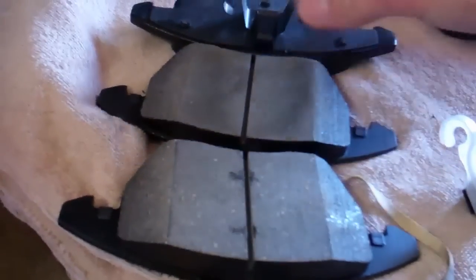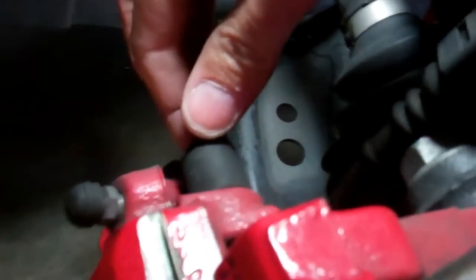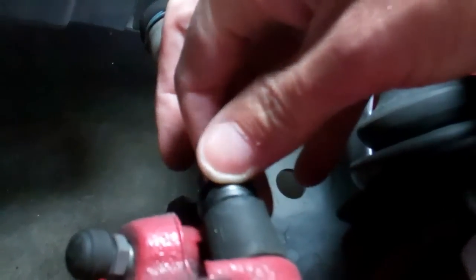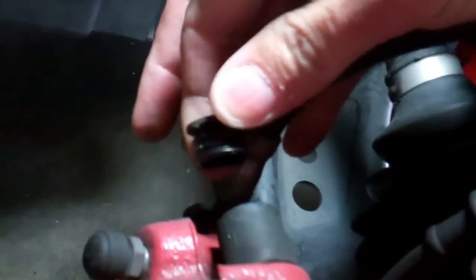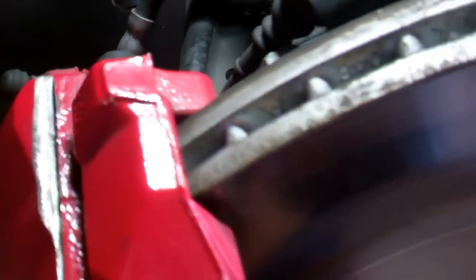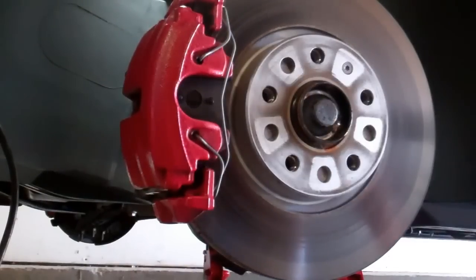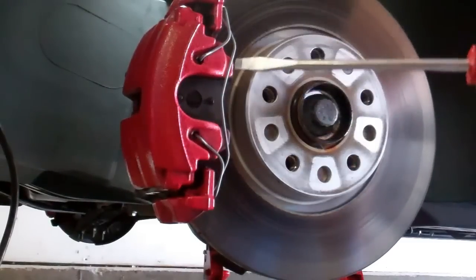And the rest of it, three pads here. I'm going to start by taking off the stock caliper. The first thing I like to do is pull off the little caps — there are I believe allens in here. I haven't done this job in a few months so I'm going to refresh on the tools as I do it. So you take off the top and bottom cap as the first step to expose your allens. And you're also going to take off your clip here. I like to first take off the clip before the allens — that's probably the way you've got to do it anyway.